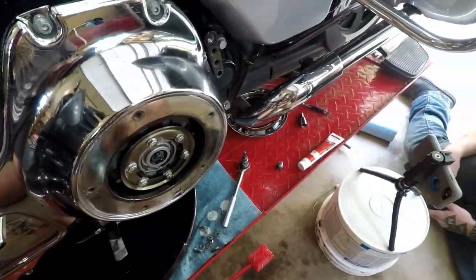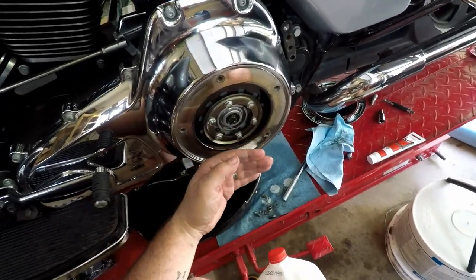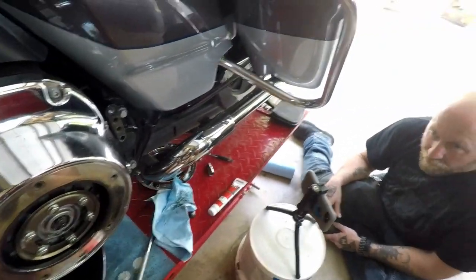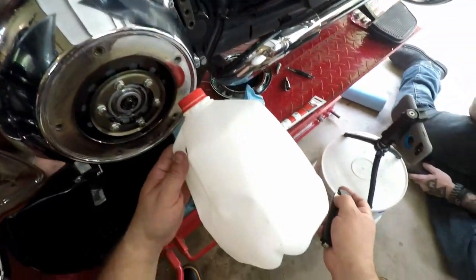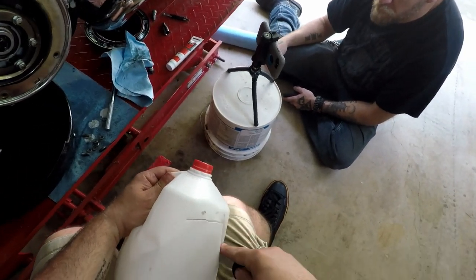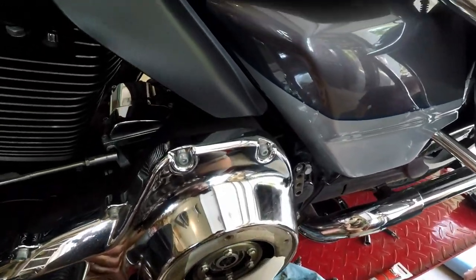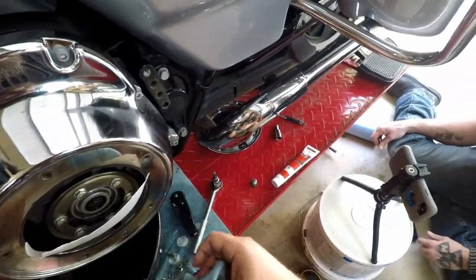While that finishes draining — Harley sells this orange plastic funnel that fits really nicely in here so you can pour your fluid back in, since there's no direct pour spot. It's about 15 to 20 dollars, so instead I cut up a plastic milk jug because my family drinks a lot of milk and it's free. All you've got to do is put it in your primary just like that — now you can fill your primary.